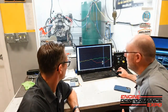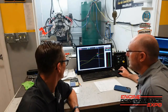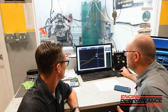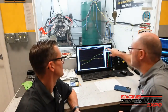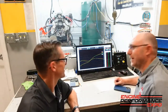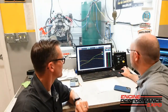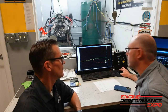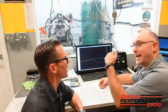Here's the real kicker — it doesn't really do much down low, but the oil pressure really starts to drop when it gets up high. Check out the difference in power though. Again, didn't make much difference down low because windage isn't nearly as much of a problem there. But after about 6,400-6,500 RPM, by the time we got to the top, it was making 630 HP this pull versus 646 on the last pull — 16 horsepower just to protect your engine. It's probably not even worth it. If it's the final round, take some oil out of the thing. But wait — there was still a little dip right at the very end. You can see it here — right around 7,000 RPM it starts to lose, which is what you'd expect. It starts running out of oil in that wet sump pan. I think we ought to put more in and try it — two more quarts.